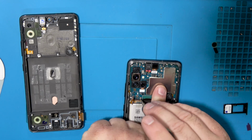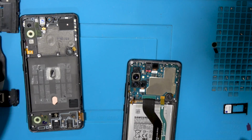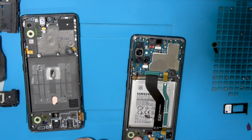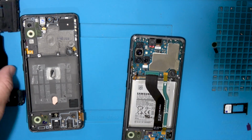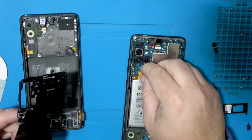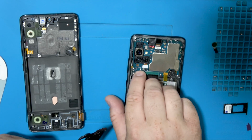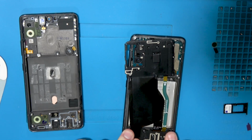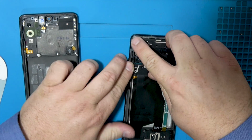which is right here. I do believe the best way to tell is always just check this. That screw was right there. What am I missing? Nothing? Okay, let's go ahead and plug the battery in. At this point, you could test it, but it will start overheating without it being pressed down against the board for cooling. So I usually just put the screws in and then test. I'm just clipping this back in.